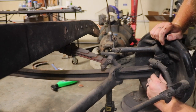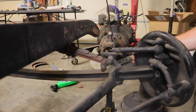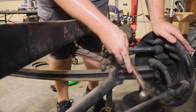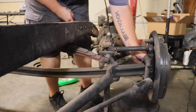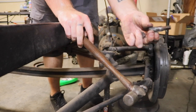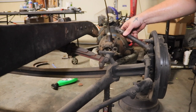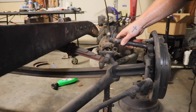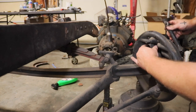What I want to do is unthread it, tap it, unthread it, tap it — because we don't ever want to hit on threads. If you leave the nut on, it's going to save the threads. There's our little kingpin retainer — save that for a rainy day. Now you can see that the kingpin will spin freely because it's ready to come out. That's the kingpin on a Model A.